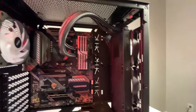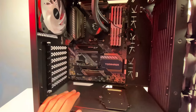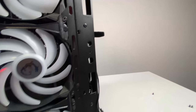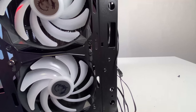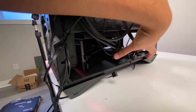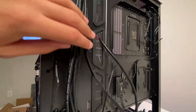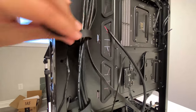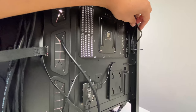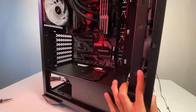The power supply is installed. For cable management, there are plenty of Velcro straps, grommets, and spaces to stuff and hide wires in the back — really nice for keeping things tidy. One small negative I noticed: the case uses regular screws instead of thumb screws on the expansion slots. Everything else is screw-based too, which means you'll need a screwdriver every time. That's acceptable for a mid-tier case, but thumb screws would be a welcome improvement.